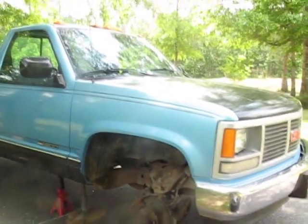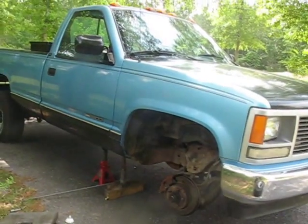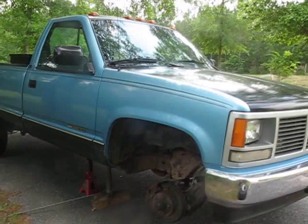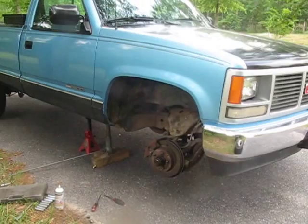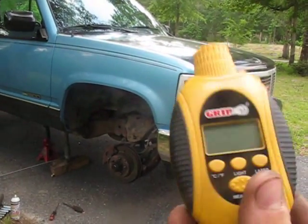I've been hunting it down, and this is how I've been figuring out where the problem lies. If it pulls to the left, then obviously the right side is braking less than the left side. So to determine whether that's front or back, I'm using my little tool here. I got it for like $15 on eBay.